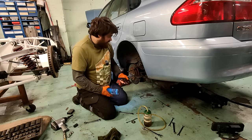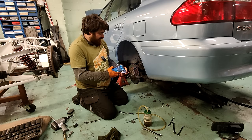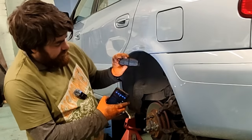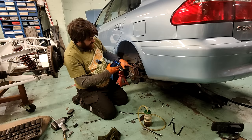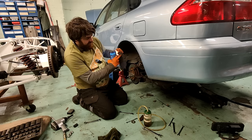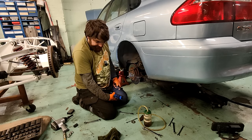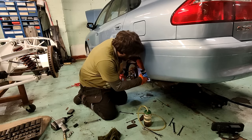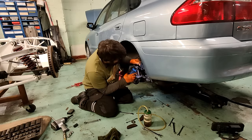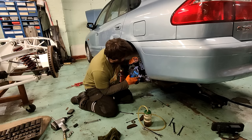Right, it needs new pads regardless, so I'll probably just order some of them. But I need to know things like, when they put the new caliper in, did they change the pads? Because if the pad is worn to a funny shape, you can see that's the one that was fitted on the outside. Had this contact patch on the disc that's not shiny. And that's that bit there. You can feel there's a chamfer in it. So one of the pads has been sat wonky. I mean, you do get that, because sometimes the sliders can be a bit worn, but this is a new... So the bushes for this, the bushes are in the new caliper, the sliders. So it shouldn't really...